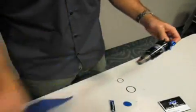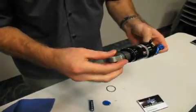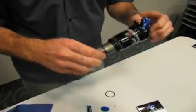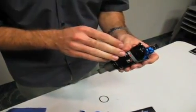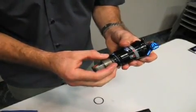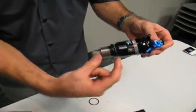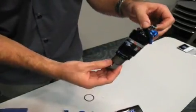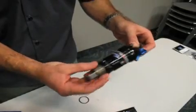The kit comes with an indicator O-ring. Once you've done this service and are ready to bolt it back on your bike, set your sag properly. We recommend using whatever pressure it takes to achieve about 25% sag — so when you sit on the bike in your riding position, on a one-inch stroke shock, you want to see it compressed by about a quarter of an inch. It's that simple.